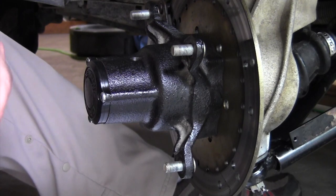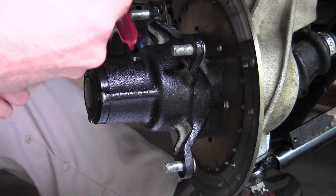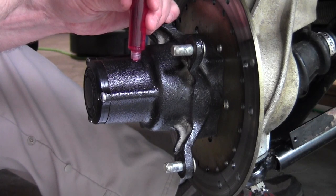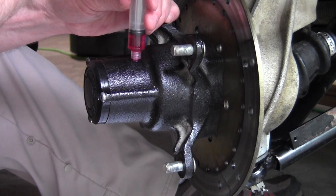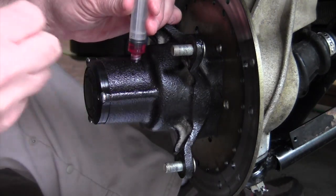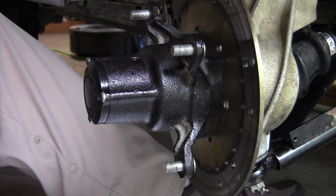When they expire I'll grab a couple. I found that this takes about 30 ml — or 30 cc, interchangeable same thing — of fluid. You don't want to create a seal on there as you put it in. You can pour it in if you want to get it all over the place; I just find this much less messy. You don't want to press the syringe hard into the hole because you can blow out the back of your seals if you create too much pressure. That was mentioned in the owner's manual, so I thought I'd pass that on.